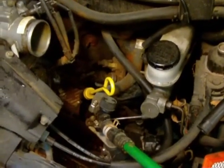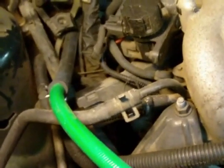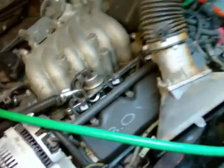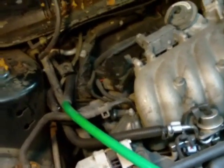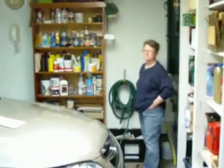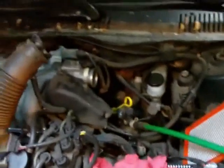Because the driver complains there's no heat. On the other end, which is the front of the engine, I removed the line that goes into the firewall and placed a piece of spare heater hose on that steel line. Into that hose I've placed this green smaller diameter hose that has a fairly snug fit, so it works really well. I can reverse these hoses easily and do the opposite, but back-flushing is the important part. I'll have my assistant turn the water on and try to contain this mess to the bucket — we're inside a garage and it's cold.